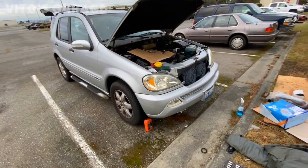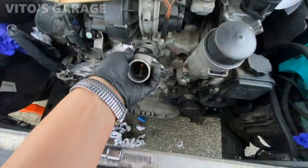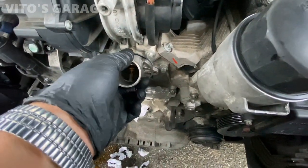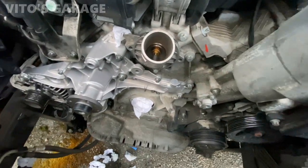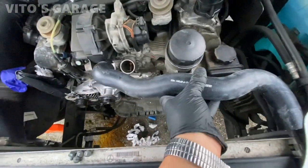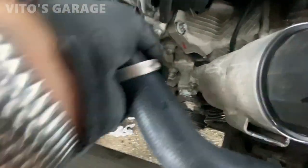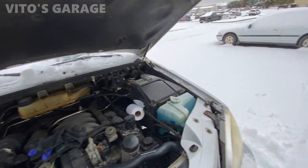About to start installing the thermostat. We got a new thermostat with a new seal. The mating surface is all nice and clean. A couple of bolts and it's installed. Right now we're installing a brand new genuine radiator hose — it's going to go right here, and I have the lower one as well. The winter is here, so unusual — I never expected this much snow. It usually rains a lot here.